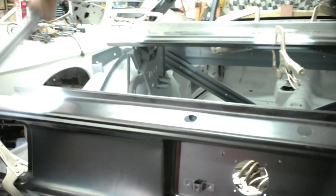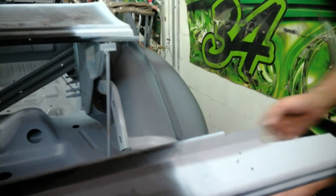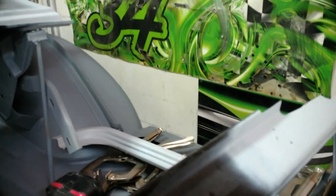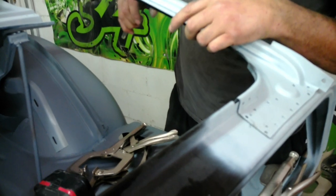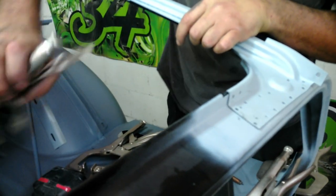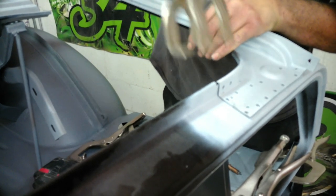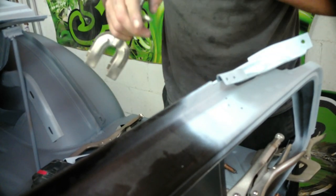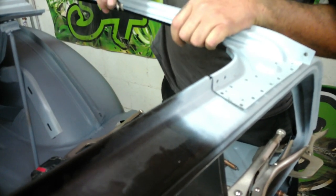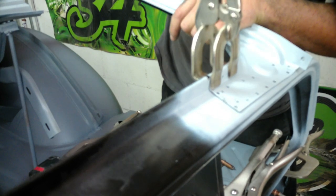Let's go get the trunk gutters in. We've got a right and left trunk gutter. Same thing — I actually got this one pre-staged. Get a couple clips on there and clamp it up, make sure it's tight. Before we put the clamps on, we'll get it lined up. This is our main point of reference here — I want to make sure both of them are together. It just drops in there and we're probably going to have to adjust these when we get the trunk on, as that's going to determine how far out between the gutter and the quarter panels.